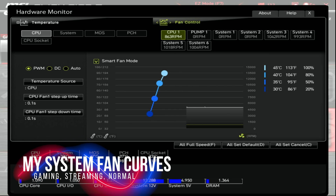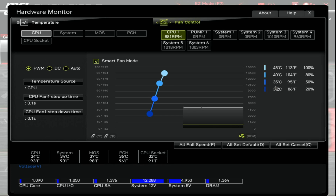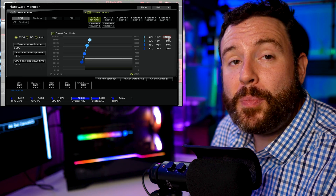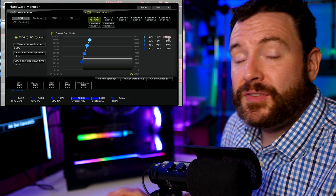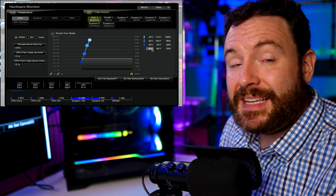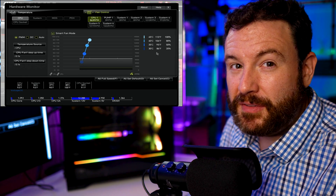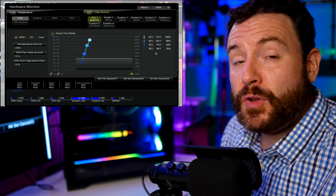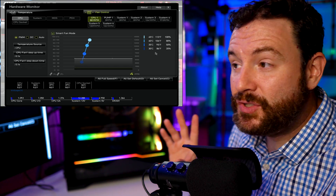Here is my Smart Fan calibration for CPU 1. You can see I go from 30 to 35, 40 to 45 degrees Celsius. At 30°C we weren't seeing a lot of load, so I have this at 20%. At 35°C I'm at 50%. At 40°C we're going to 80%. And then at 45°C we're at 100%. It's not necessary to run all fans at maximum RPM — even during gameplay our CPU wasn't necessarily exceeding 45°C. You don't have to ramp this hard and fast, but this is a starting point I'd recommend most people dial into. If the fans are too aggressive, that's okay to back off.